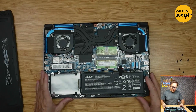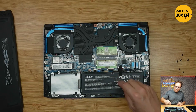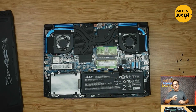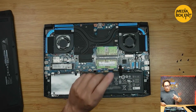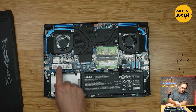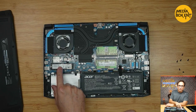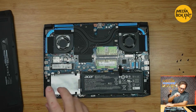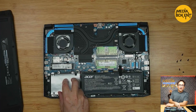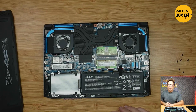So we see the laptop right here. We have the two memory modules. Remember, you can upgrade up to 32 gigabytes — this one has 16, so you can go all the way to 32; 32 is the limit. This is the original 512 included with the computer, an M.2. We can install a 2.5 solid-state drive here, and right here we can install the M.2.